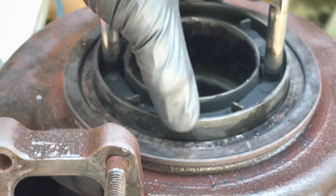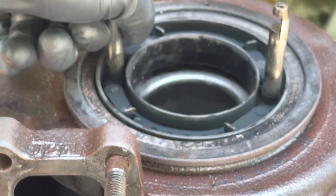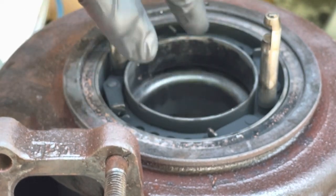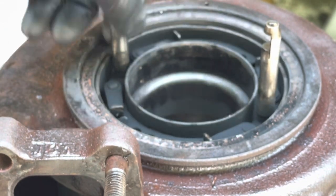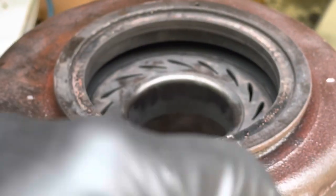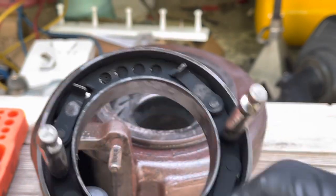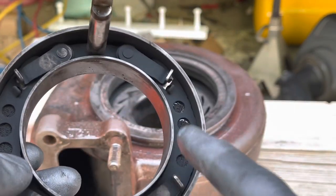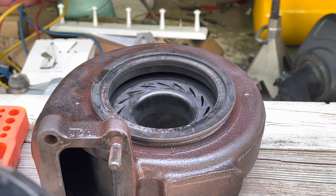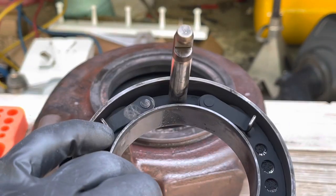This is the original OEM one so there's some play in there. You can hear the step - it gets hung up and just stays up. That's what's causing our problem. Another thing that happens with these VGT nozzles is the tabs break off - there are little filters in here. The upgraded ones do not come with the tabs or any filters. We're going to get rid of this and get a whole new rebuild kit for the turbo and new VGT vanes so we don't run into broken tabs.